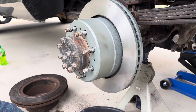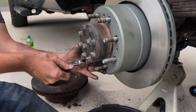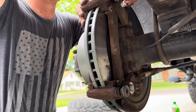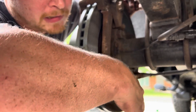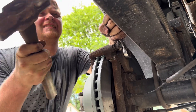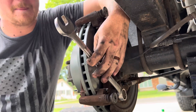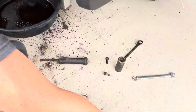That's why those clips come in handy that you didn't want. Give me a lug nut — for holding the rotor, one lug nut comes in handy. Do you worry about how much torque you put on it? Just go old school — good and tight, that's what I do. Just throwing a little bit of grease inside where the brake pads slide; keeps the rust away.